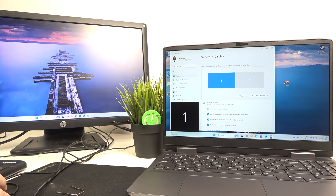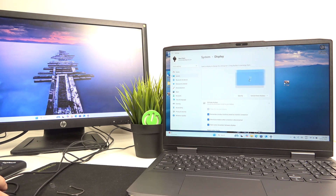I'm gonna click on identify, then it'll show me on both displays the number that the display has, and I'm gonna rearrange them and apply. Now as I move my cursor to the left side of my laptop, it moves onto the monitor — so now I have it here and now I have it back here.